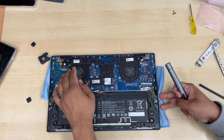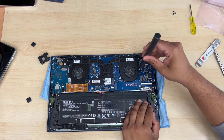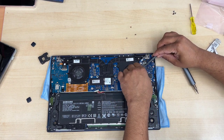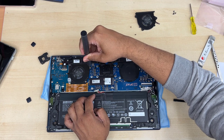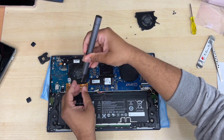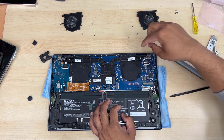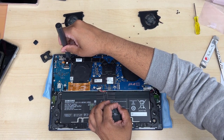I can see the CPU and GPU fan — both have three screws each, so we have to remove three screws from each of them. We also have to open the latch to disconnect the flex cable. That connector is very sensitive and very tiny, so make sure you don't apply too much pressure, otherwise you're going to damage the fan connector, and if you damage it, it would be very difficult to repair — you can't easily get that connector from the market. As you can see the fans look quite clean, but the magnet is gone from inside, and that's why it's making a lot of noise.